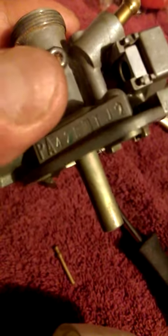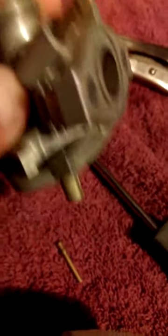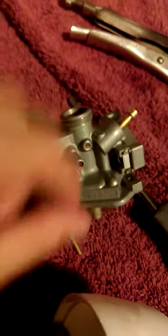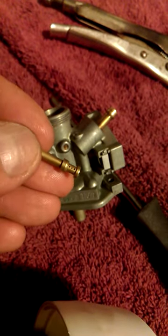Orient the bottom of the carb — it fell out — so you put this flatter part up against the vice and kind of sit it down. Your vice grips will hold the pilot jet, and you tap it with a hammer. You can see pictures, people have done it. I had to whack it a couple times and increase the pressure on the vice grips a little. Then I started noticing the little edge starting to come up, and boom — next big tap and it just whacked out.